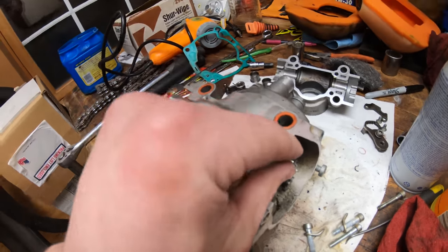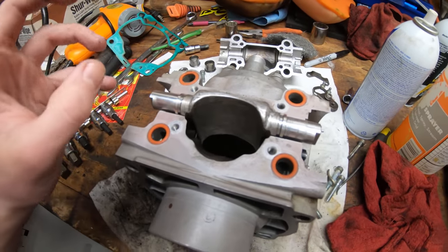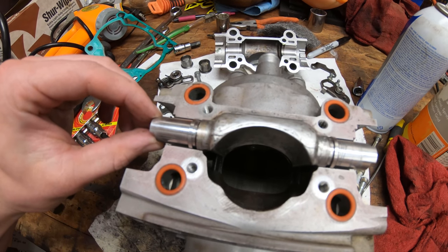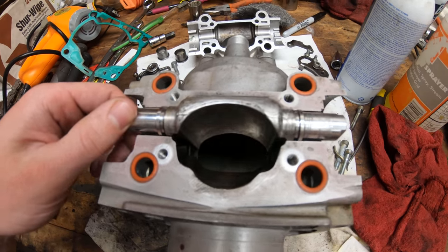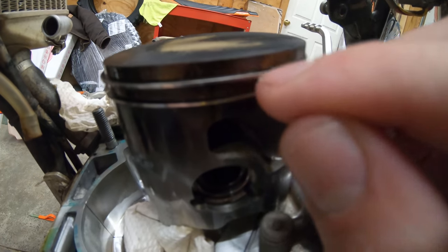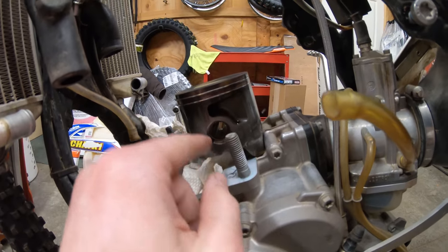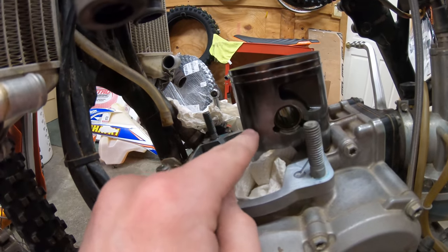When the flap opens up, that's when you hear that sound. If this area is all clogged up, you're losing power. There are also some ports on the side here — they open and close the same way. There's actually a worn edge on these, so the rings are due. And this blow-by here definitely tells you — it's getting by both rings, so you're losing power.